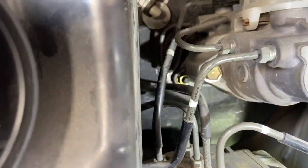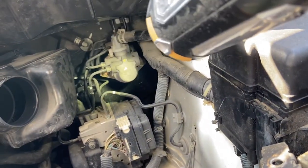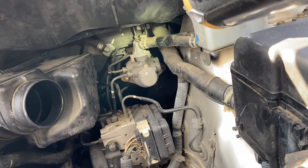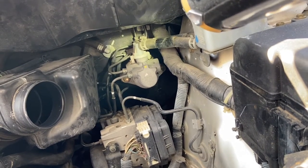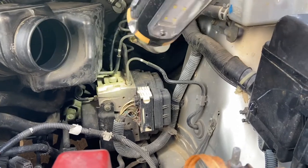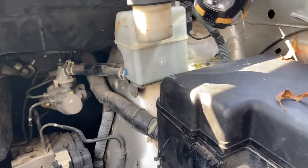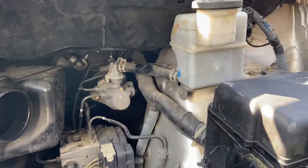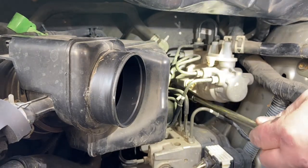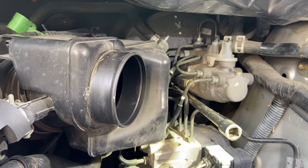There's a mounting nut in the bottom left corner against the booster back there, and then a top right and bottom left. We're going to take those two mounting nuts off. On top of the master cylinder back here is a steel line that goes to the ABS manifold, and then there's another steel line on the front that also goes to the ABS manifold. We'll unscrew the reservoir and then pull the whole assembly out to the bench. A 12-inch 3/8 extension with a 12 millimeter socket reaches all the way back to the nut — straight shot, no u-joint needed.